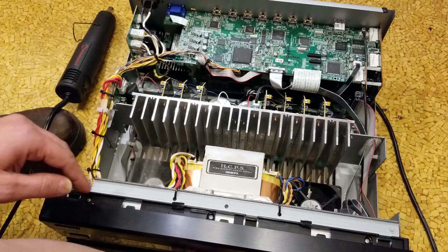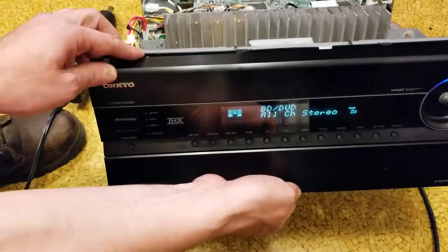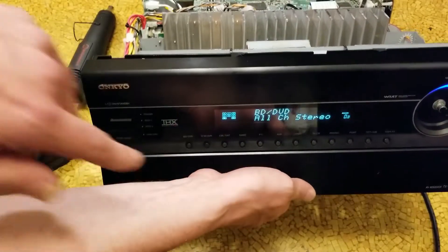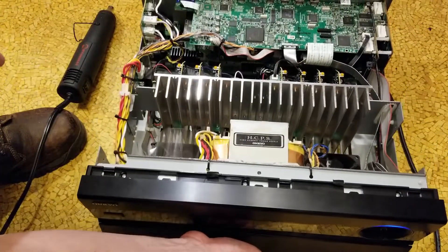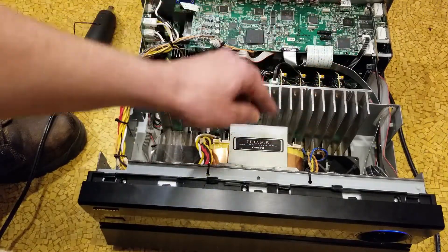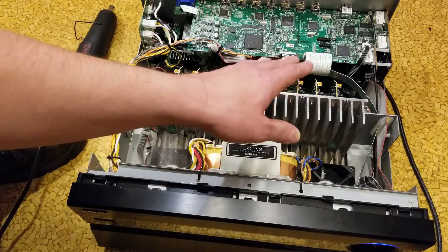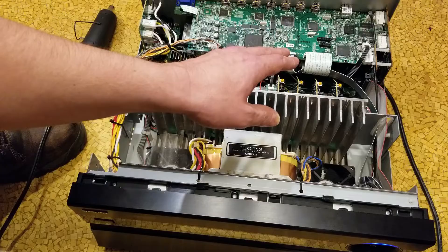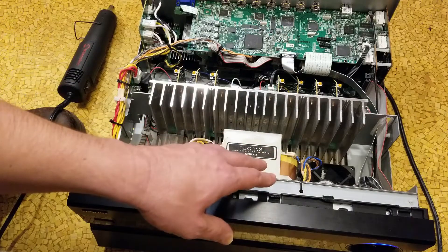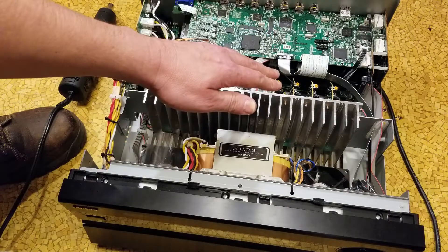This is really good news. Just doing that heating up — here, this is the speaker grid, and look, it came back just from heating it up. Amazingly, this may be one that's solved by the heating fix. I tried pressing down on the chip, that didn't work, so I heated it up. I did another factory reset and the speaker icons came back.